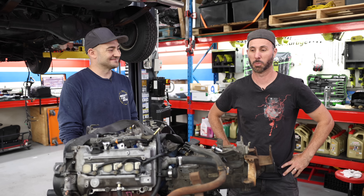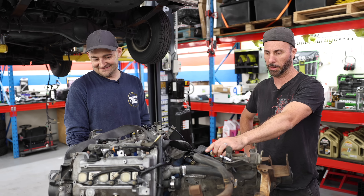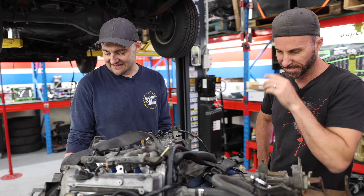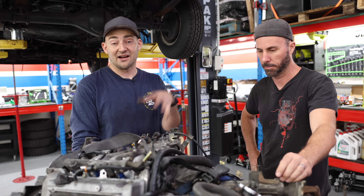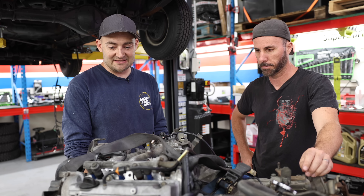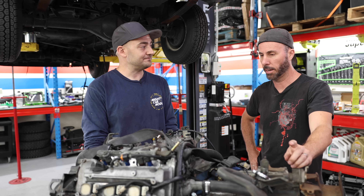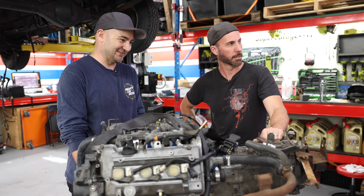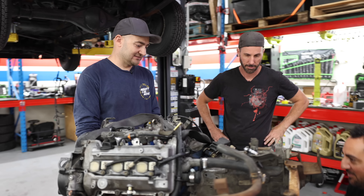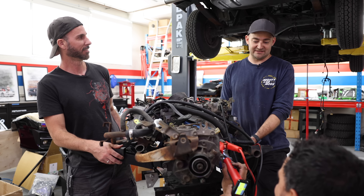The loom is finished because Dave is a wizard. The coolant lines are on, thanks to bits of hose, clamps, a door stopper, a foot off a chair, an angle grinder, and a bit of hose from an EZ30. We want to crank it and just make sure there's oil circulation, no leaks, nothing weird — this is easier to do outside the car. We can activate the starter motor and make sure everything turns as it should before we put it into the engine bay for the last time. This is three different cars combined that are not meant to go together. Let's give it a crank. It clicks but doesn't rotate. It just doesn't work.